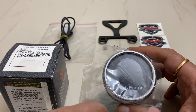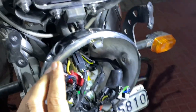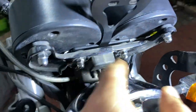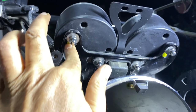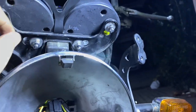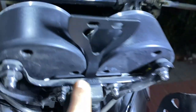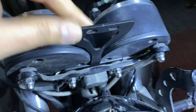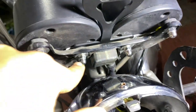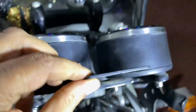This genuine Royal Enfield accessory was the right approach to get both time and tripper navigation to complete the setup. To fit the clamp for the navigation pod, you have to open the visor — the front door — and loosen the four bolts so the material comes up. Ensure that there is a washer here; you have to keep these four washers safely, otherwise they will fall down. Once you remove this, from the two grooves above you insert the bracket after removing the meter.